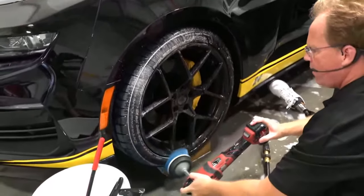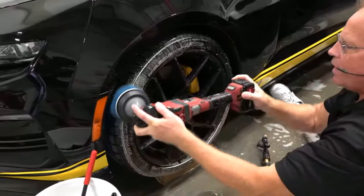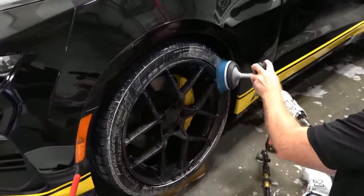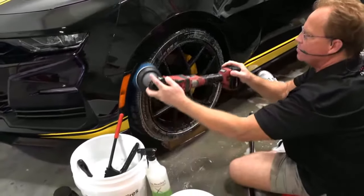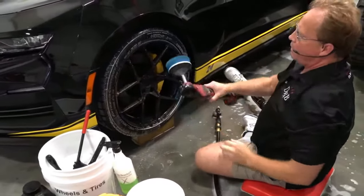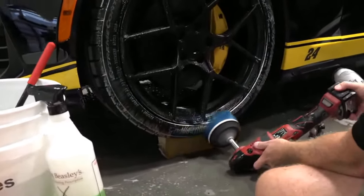So I sanded about half of this car to remove orange peel surface texture and solvent pop. And then I came back and took a wool pad with a rotary with NSP 150. Then I came back with 95 and a foam pad, and I actually finished out with 45 and a Porter Cable again, because most of the paint on this car is incredibly soft. Okay, and this is why I put this on blocks, so you can get down here and get what's called the flat spot.